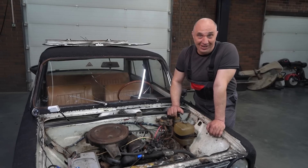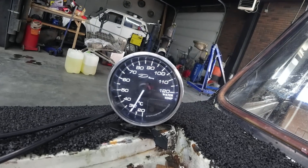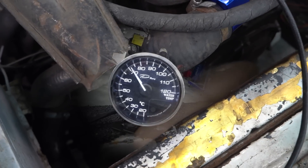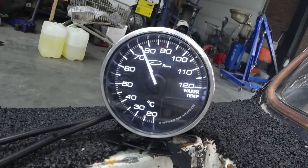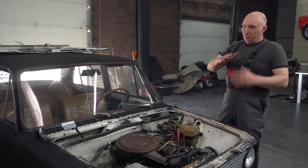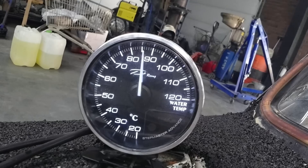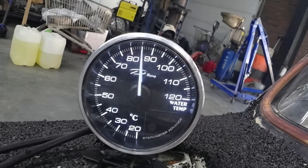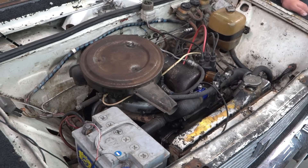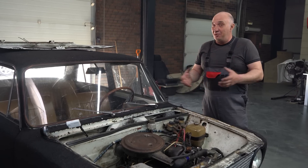Okay, now we wait and see how fast it gets up to temperature. The engine is at operating temperature, and the thermostat is just about to open. The gauge is showing us about 80 degrees. The thermostat opens, cold water finds its way into the block. The temperature drops slightly, but of course we'll see it slowly rise back up again. And now we're about to find out whether the cooling system in its current state will be able to keep the engine temperature at bay.